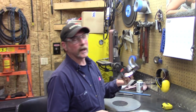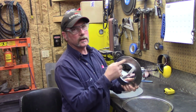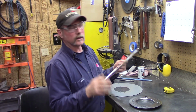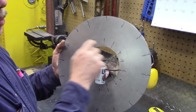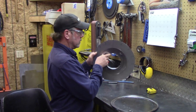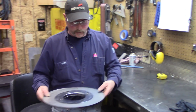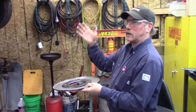So here you see the manufactured part from the air cleaner that goes on the carburetor. We couldn't do this. Then you've got the outside where the filter used to go on a 14-inch air cleaner. We couldn't make that corner because we don't have the tool. But we made a disc and measured it all out. We're going to drill holes for plug welds and attach these two. Then underneath, this will be connected to this. And that's it for the night. We'll have this base ready, and then we're going to have to make the lip that goes up.